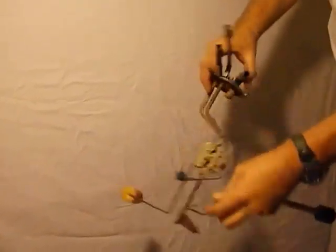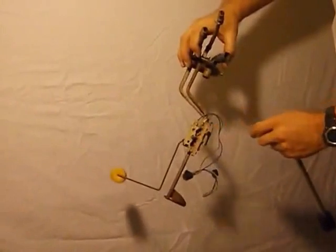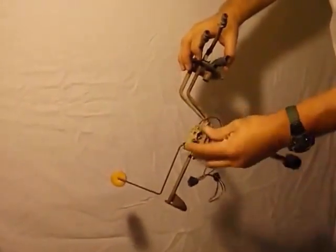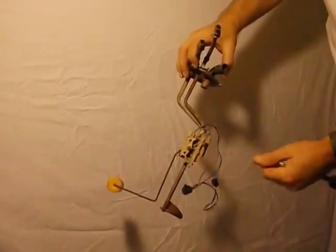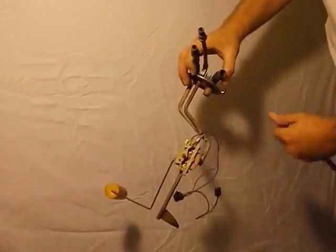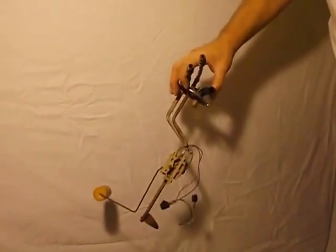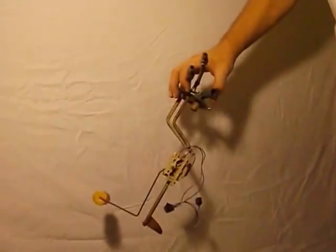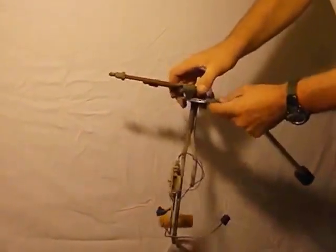You can still see the ugly wiper board here — this is the whole problem. Those wear out and are exposed to the fuel, so over time they corrode, tarnish, and whatever else goes wrong. This causes your gauge to bounce. So if your gauge is bouncing or you're getting an inaccurate reading on your fuel gauge, likely this is the problem.